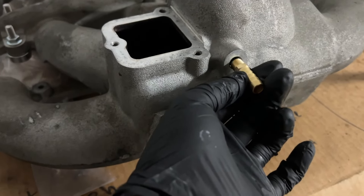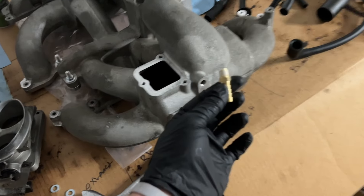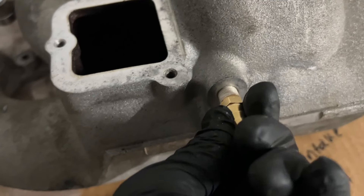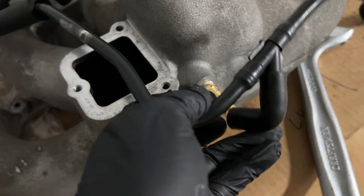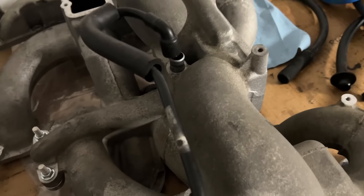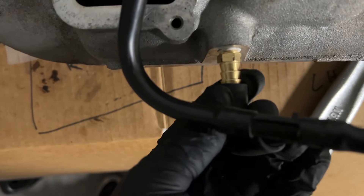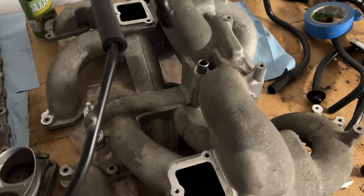These tools are incredible — I was able to use this for my BMW too. It takes a separate fitting on the end but they're swappable. I'll leave a link in the description if you're interested. Definitely worth every single penny. The fitting has arrived and it's going to work. I used thread sealant sauce — smells like peaches and green oatmeal. Just buy a 3/8 barb fitting and it works beautifully. That one goes up here, this one in the middle goes down there, and that one goes to the valve cover. Now we have both sides of our PCV situated. Let's go!